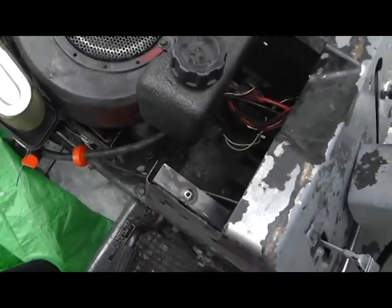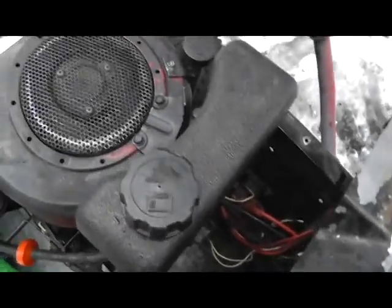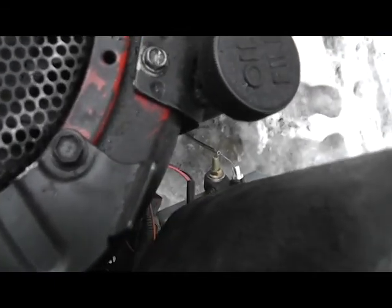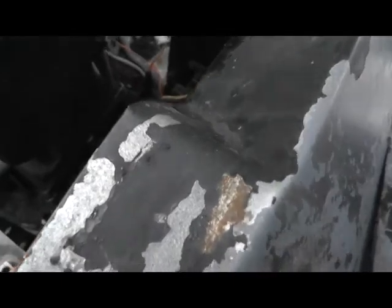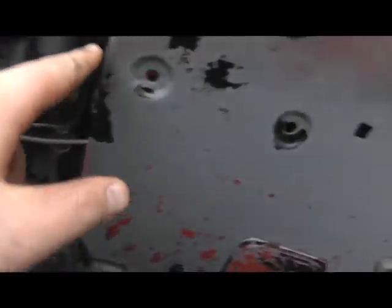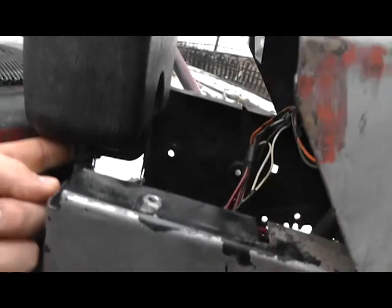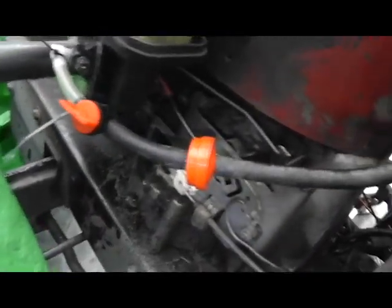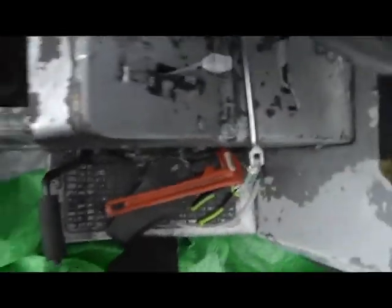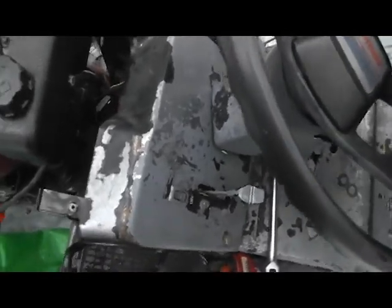Alright, by this gas thing I put on here myself, I had to cut the fans inside. If you're going to ask me if it's even — it's even. This gas tank — the original one was right here, it was gravity fed, it was awful. The nipple was about this far down and there was like no gravity. This one is way up here, so that's a nice drop down there. I'm just going to screw that on. All the safeties on this thing are bypassed because I'm not using it for mowing anymore.